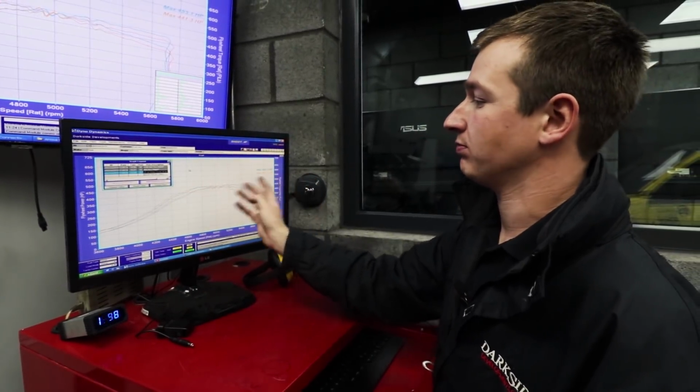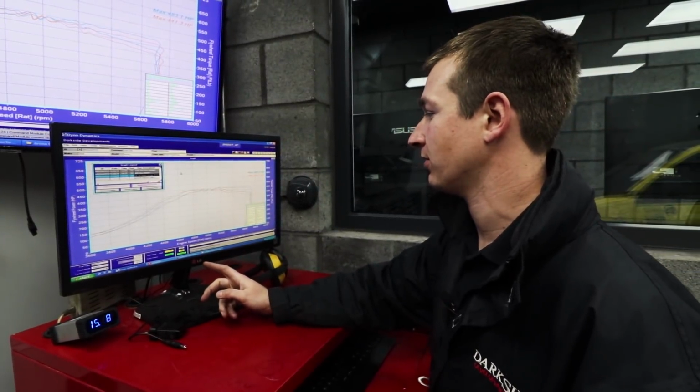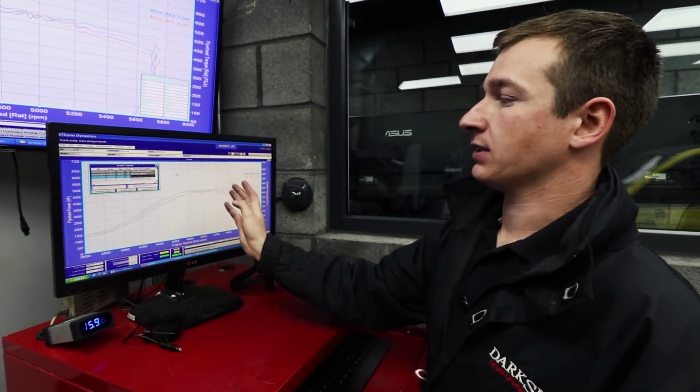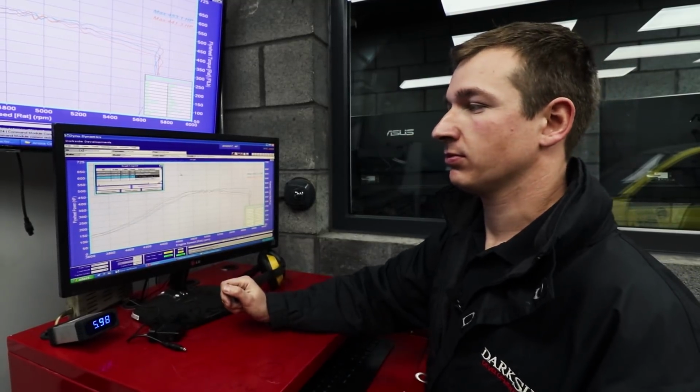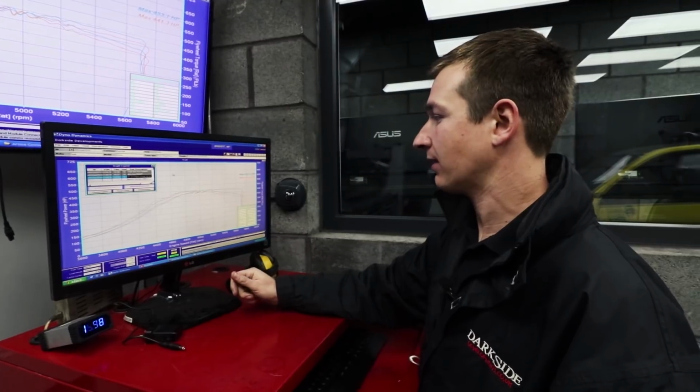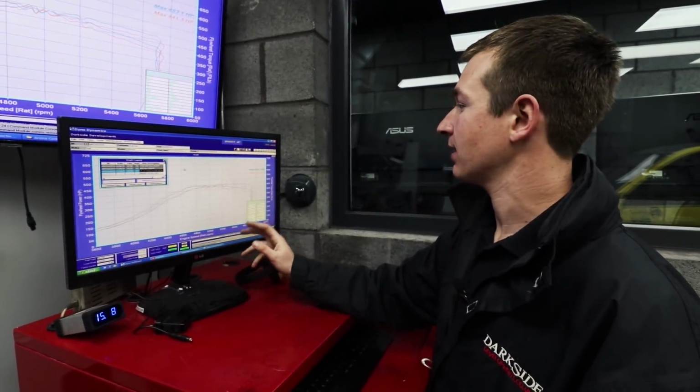You can see it's very laggy, especially on the dyno, because it's only a fairly short pull in fourth. On the track, we're getting full boost, close to 4,000, but we're revving it to 5,700 anyway, so it's a decent enough power band for drag racing.